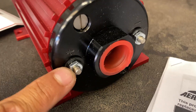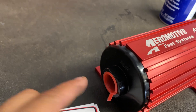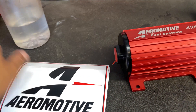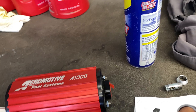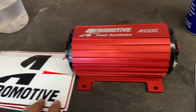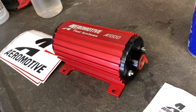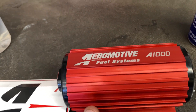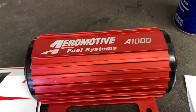The pump has a positive here, this is the outflow, and this is the inflow — so this will be going from the tank, and the filter would sit on the inflow side. Anything that comes in through the filter gets filtered before entering the fuel pump, so it's clean going out to the engine. We're going to go ahead and bolt this back in, get everything back into location, and hopefully fire it up and be back to new — or better.